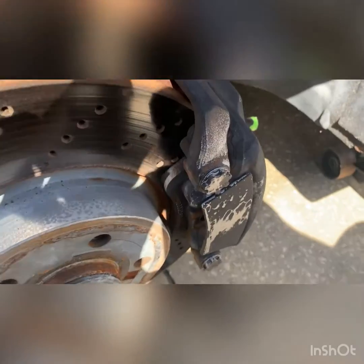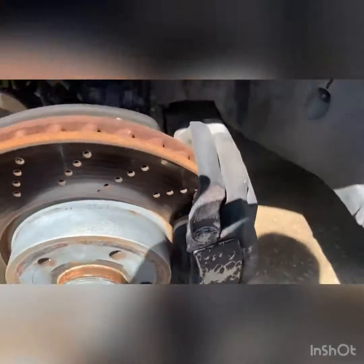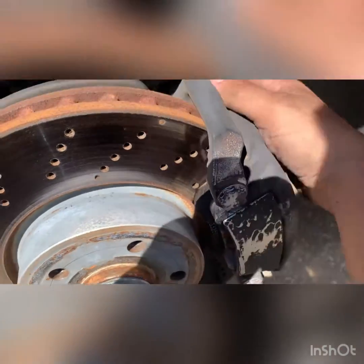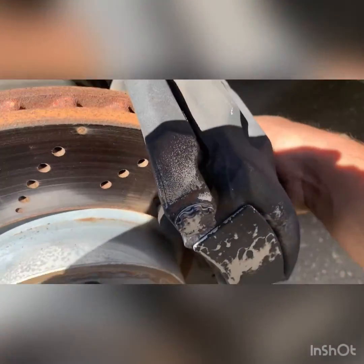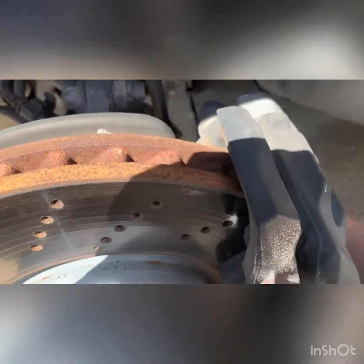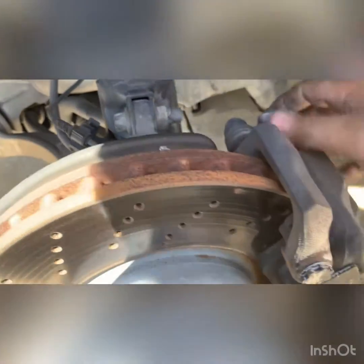Once you get the spring and the top bolt off, what we want to do is go back to the back one and loosen that, and we'll see if we can just angle this out. Once you undo it enough, you can unscrew it like the top one. Just pull it out, and then that should allow you to swing this thing out. It's kind of stuck in there now. Make sure to pull these pins, casings out still, so there's room.